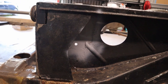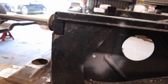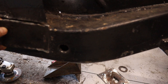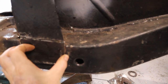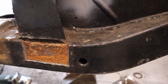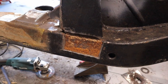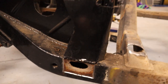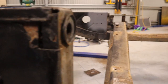Okay, so I got told to have a look at this section here just from the Facebook page — the HQ to WB Facebook page. So I've cut this piece out; I've been told that it rusts underneath there. I have cut that out and as you can see it is pretty rusty, so that'll need cutting out and a new piece welded in. Cut the right hand side piece out just where the support for the tray and the cab mounts go.